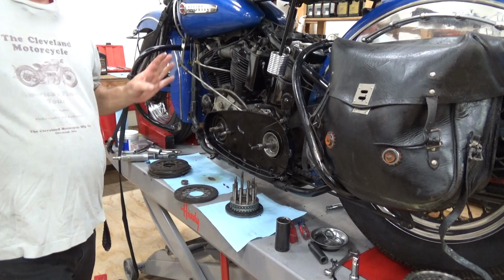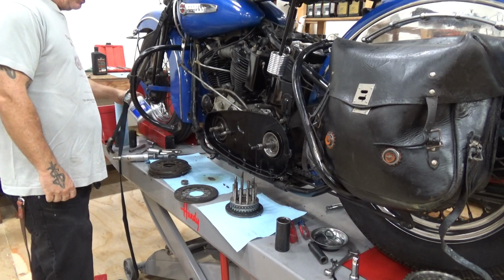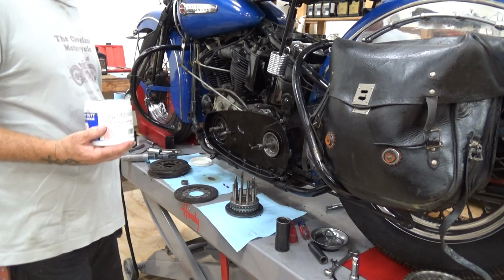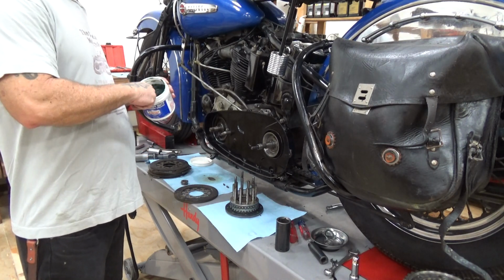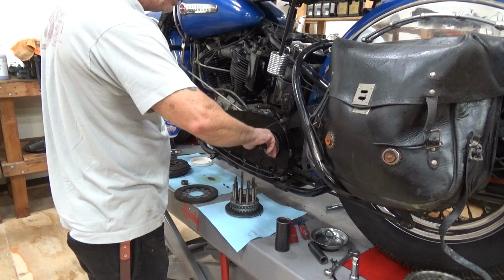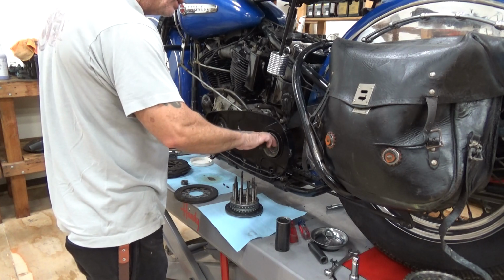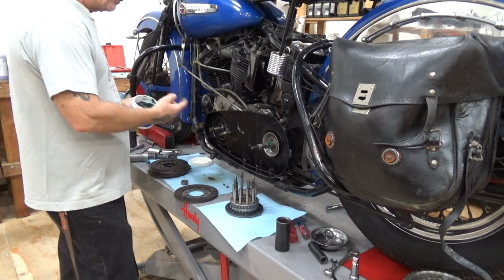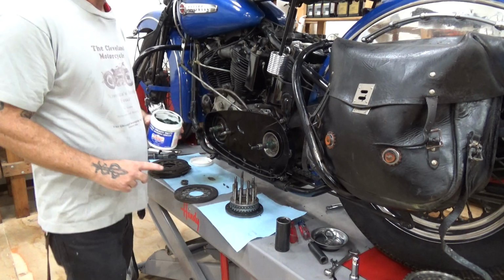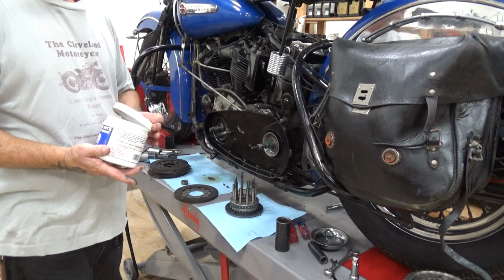It's your bike. You can do whatever you want to do. I'm going to show you what I do, and I do it every time. I've done it for 35 years. And guys came to me with 10 to 15 years experience on me, so that's a good 50 plus years or better, because they learned it from someone. You grease your shaft. It's a tapered shaft. So what that means is that you have just enough molecules of grease in here to make sure the thing doesn't weld itself. You destroy your shaft. Punch-up's nothing. Sprocket ain't so easy to get, but punch-up is nothing. Okay, but how do you want to rebuild your motor because you didn't grease it? I've seen it happen. You betcha. Destroyed. Take a torch and cut it off.